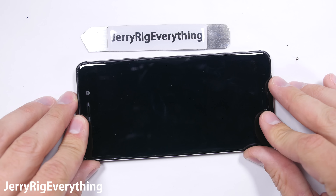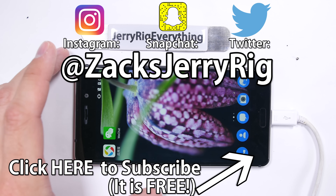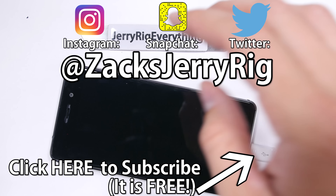You can screw the bracket in place now if you have your screws organized, or just wait until the back metal panel is in place. There are 6 more screws holding down the motherboard, and don't forget to plug in that bottom left wire cable either. Since mine is broken, I'll just have to live with it until I can get a replacement wire. The battery gets set back into place but not plugged in yet. And finally we can plop that metal mid frame down into the phone — it has two tabs along the bottom that need to be set in first, and then the rest of it can be pushed down. Now we get to sandwich the metal slabs together with the 19 little screws.